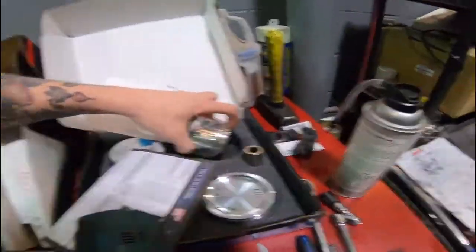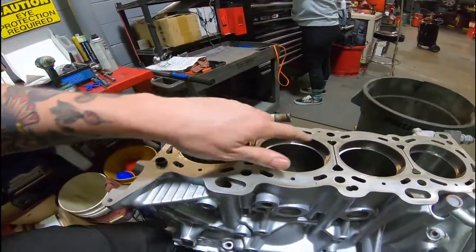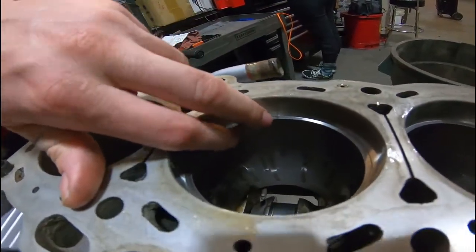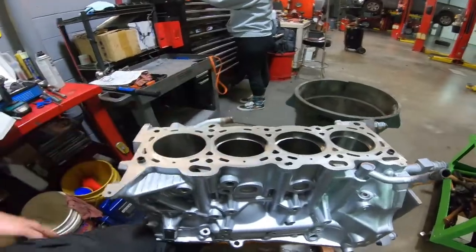The reason ring gap matters — you may have heard about Subarus popping off ring lands. Under high boost, the compression heat gets super hot. When that happens, the rings start to expand too. If those two ends start to touch each other and there's no more gap, you can't allow any blow-by gas to escape — that's when you're going to kaboom the whole thing, especially with nitrous.